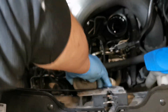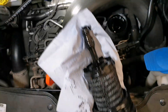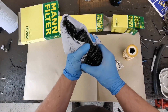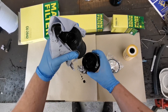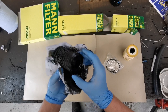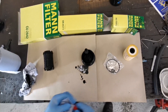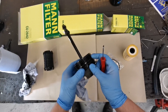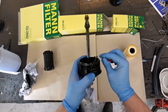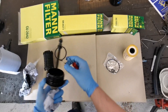When the oil filter is loose, make sure you've got some blue roll handy just to catch any spills. We can pull off the old oil filter from the cap and get on with removing the seals. It's worth checking if there are any characteristic differences on each end of the oil filter so that you don't put the new one on the wrong way around. With a small flat-edge tool, just prise away at the old oil seals without damaging the plastic.